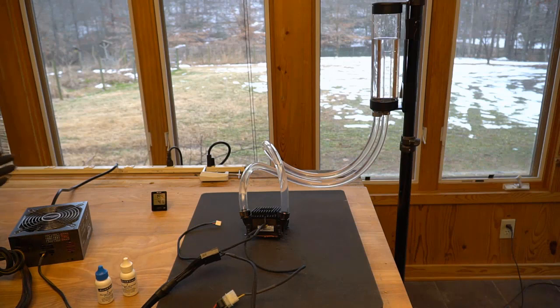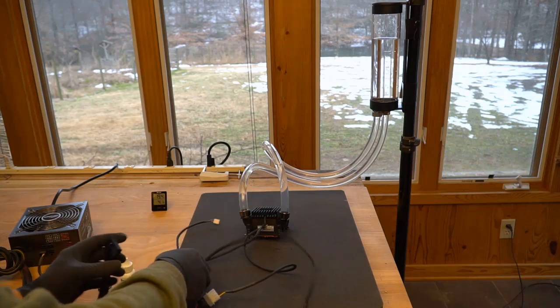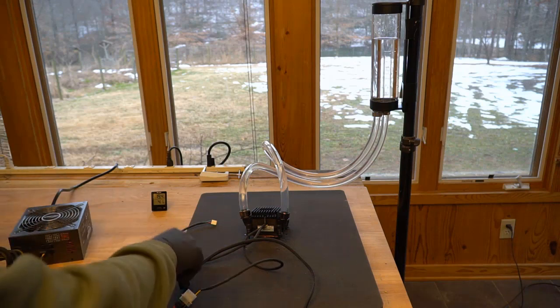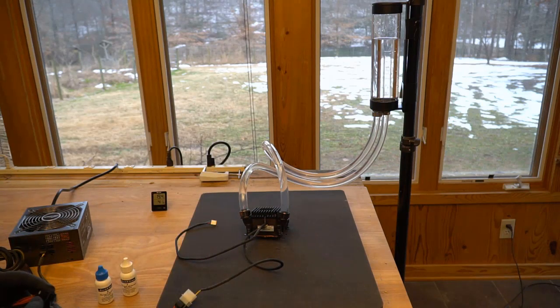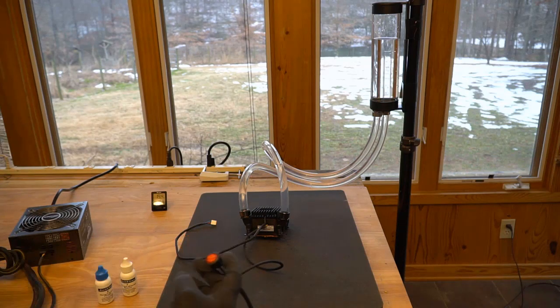If you just did a block, you could also do it from the power supply. This is just a bit more convenient. So you can control the pump on and off without having to have the computer committed to a complete start cycle. So I've got a funky test power supply here, and I'm going to plug my cable into my power supply. My power supply switch is now turned on, but my power supply isn't lit because I don't have this switch in the on position. Once I turn this on, it's going to supply power to my pump.